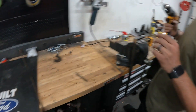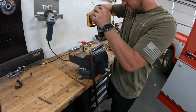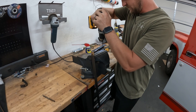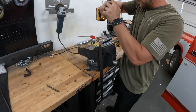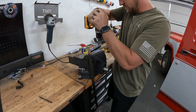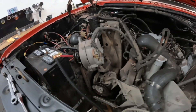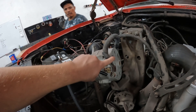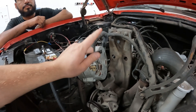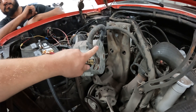Drilling is finishing up our mudflap brackets. We got some nice forward mudflap brackets — making our own since the factory brackets are way too close to the tires and we're running 35s, so we had to relocate. The alternator's coming off — we'll crack the case open and inside put a terminal on the W wire. We take our W wire, hook it up into our gauges, and the Dakota Digital module will convert that W wire signal into a tachometer signal.